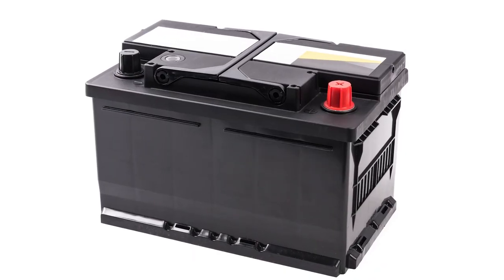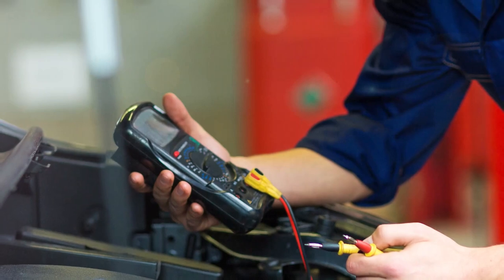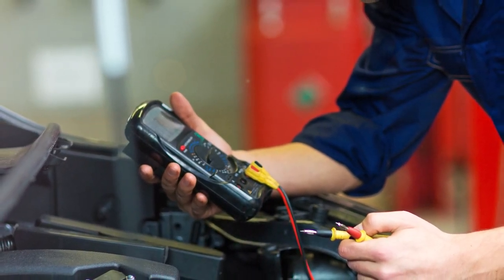The use of systematic diagnostics is crucial. A repair facility needs to follow these steps. Verify that the battery is correct for the vehicle — without the proper battery, there may not be the required amperage available to properly operate the system. Check its state of charge. Just like the correct battery, it needs to be at a full state of charge. Without this, the system may not operate or test properly.